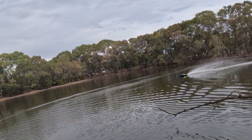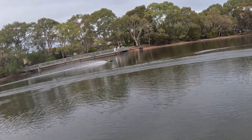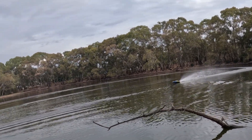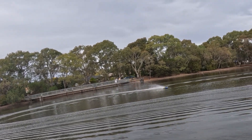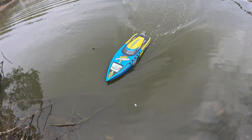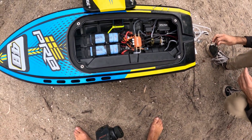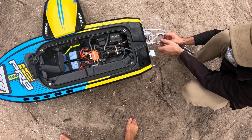Okay, that's flat out - it's actually a bit faster than I thought it was going to be. So that did 50.9 km/h. I got 67 km/h with the stock motor on 8s yesterday. This is only on 6s and lower KV - 950 down to 800 - so let's get the bigger prop on there and see what it does.